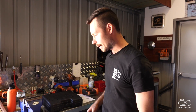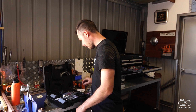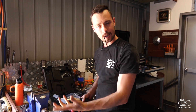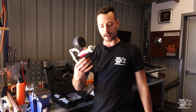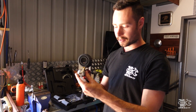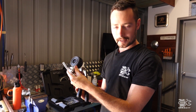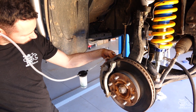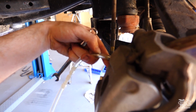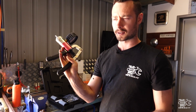I'm just about getting ready to bleed the brakes because we've done the brake lines. I wanted to show you this tool from ToolPro. A lot of times when you bleed the brakes you've got your mate pumping the brake while you're letting the fluid come out, but what they've come up with is this device that means you can bleed your brakes with only one person. There's two settings — it's called in and out. When it's on in, it sucks fluid in and you fill up your reservoir, suck the fluid through, and it gets all the bubbles out. And if you go on the out setting you can actually blow air into it to clear a brake line out if you're going to remove or change it or there's a blockage. I picked it up from Supercheap — easiest way to do my brakes from now on.